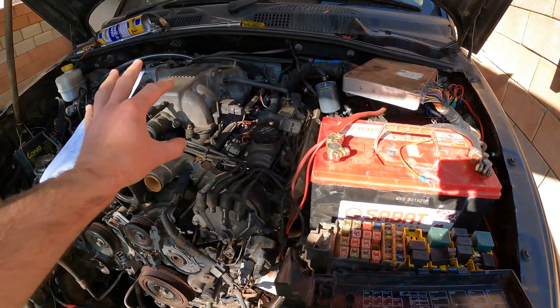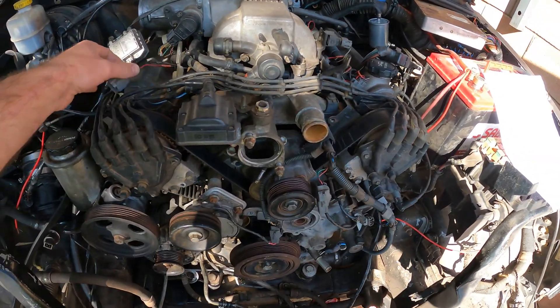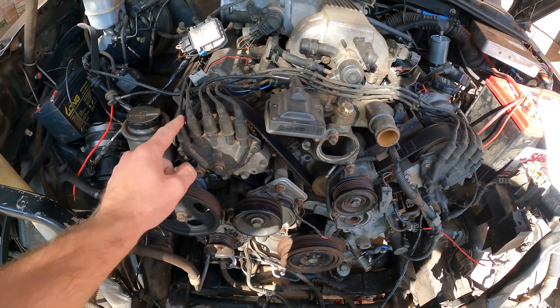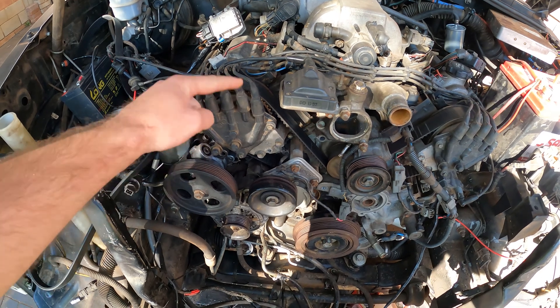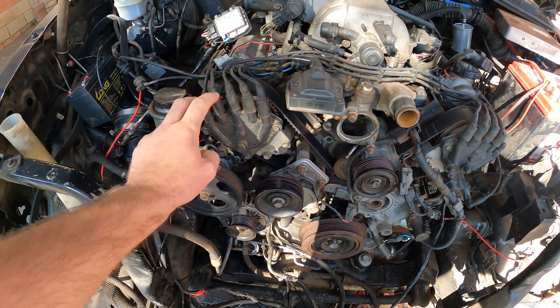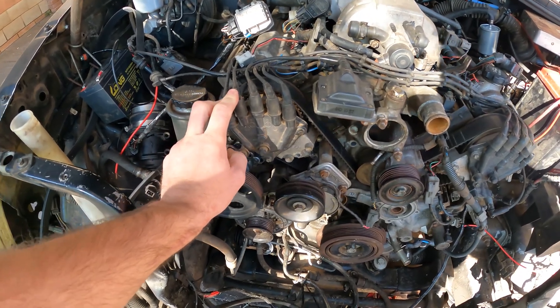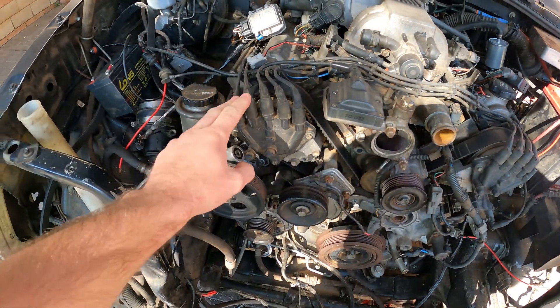So let's quickly do this side and write down the numbers. I have found a small mistake — to be honest I got the engine like this. So number two and number eight — this is from the coil — that's number three and number five. These two coils were switched over. That could cause two cylinders to misfire obviously, so I'm starting to wonder if this was not my fault from the start.